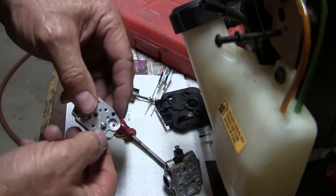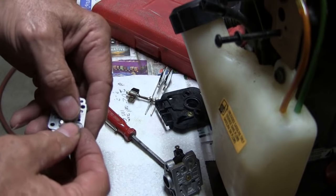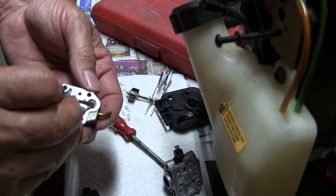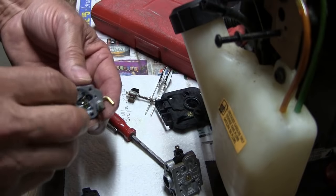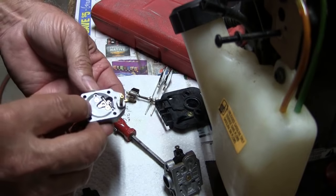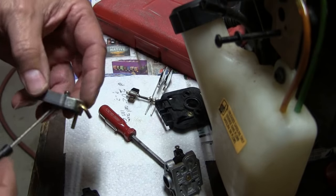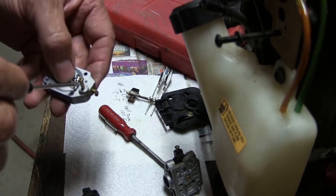I just blew the screen. Little tiny hole — screen goes in right on top of that. When I blew into here, it blew the screen out. Lucky thing I had my hand on it. I've got an orifice there and there and another hole there — better keep these covered up. Here's a screw holding it. This looks like it's spring-loaded — here it goes. So that's a little valve there. It opens up a hole over here.